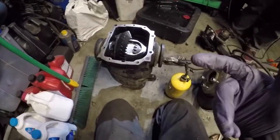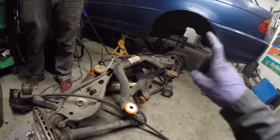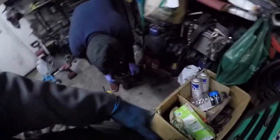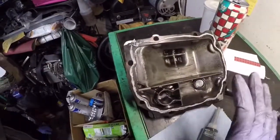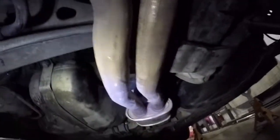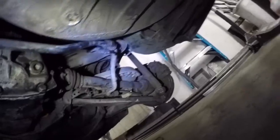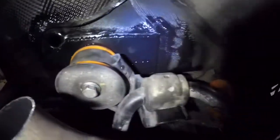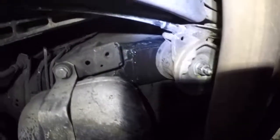We're going to put it back together, let it cool down, fill it with Kendall oil, and slam it back in the rear end. Now we are resealing the diff — we put some Ultra Gray by Permatex on it, smooth it out, and it will go back on to factory torque specs. We have the subframe back in, everything is torqued down. We recommend that you paint mark everything as well, so you can tell if nuts or bolts have spun or moved on you. That's what it looks like all back in. The plates are all welded in — you can see that plate there and this plate up in there. Now we should be good to go and nothing should break off. We'll catch you guys next time.